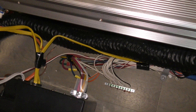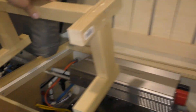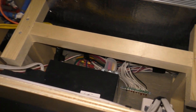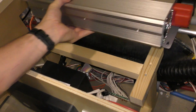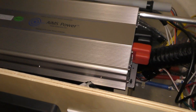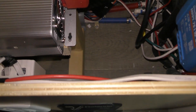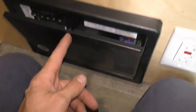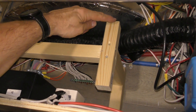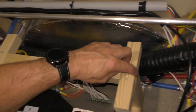I thought about moving stuff around down there, but then realized the inverter fits right in the top here, so I made this little bracket and it fits right down in there. The inverter can sit right on top of it. Now I've got to put some holes in the floor for the battery cables to come up through, and figure out how to wire the rest of it, taking into account the ability to shut off the charge converter so it doesn't charge the batteries while the inverter is using them. The space dimensions are 7¼ inches by 18 inches, and 9 inches from here to the floor.